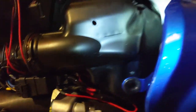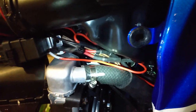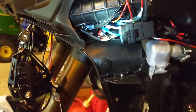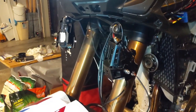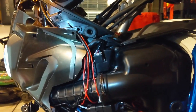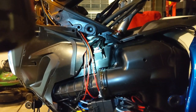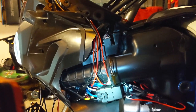I think you have to take the tank off to get to the air filter, but I don't want to mess with it now. I've got my power wire coming in - it comes into the relay here. I had to end up wiring the two switches with the right-angle terminals going toward each other, so they kind of interleaved, like a finger joint. And then I was able to get these wires to come down here.